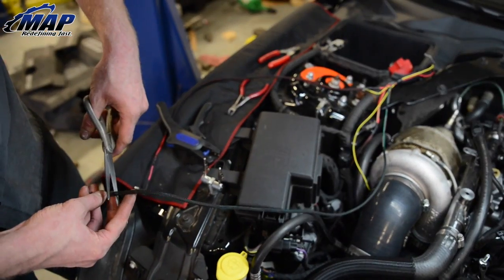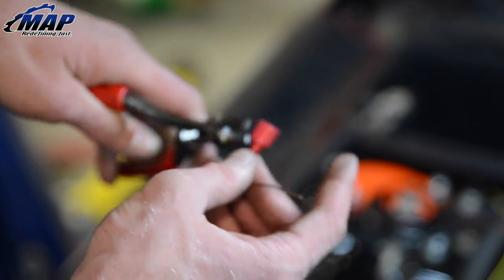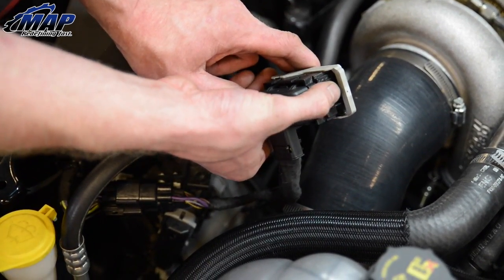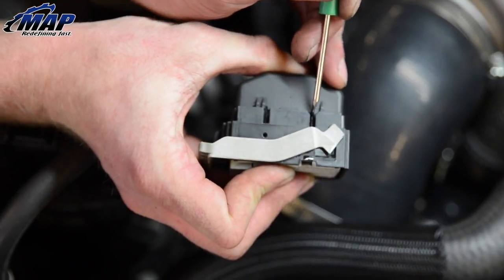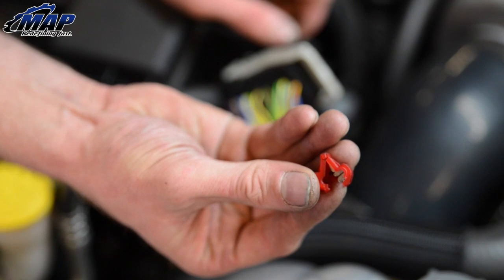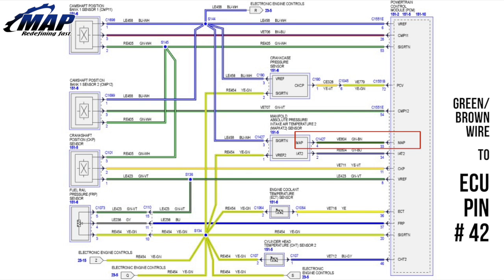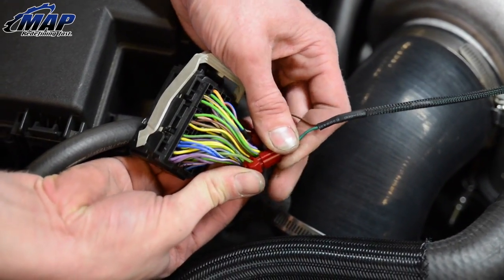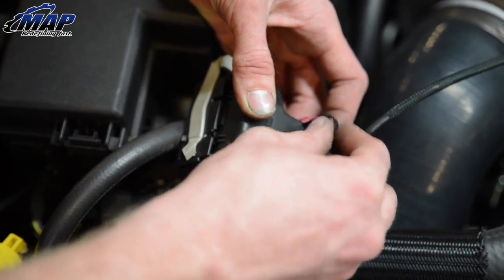Next, the brown and green wires will go to the ECU. Tape them together and attach the wire sleeving. Shrink wrap both ends, cut and twist together. Attach the protective spade terminal and crimp to both brown and green wires. We will come back to this later. Next we will pull the top connector plug off the ECU. Push down on the top black tab and pull the gray lever back to release. Cut the zip tie and press the gray lever forwards. Use a pick or other tool to press the two tabs down and remove the black cover. Crimp the two red T-tabs onto these ports. Attach the brown wire here and the green wire here. Clip the black cover back on and zip tie to secure, then plug back into place.